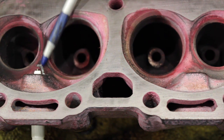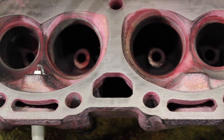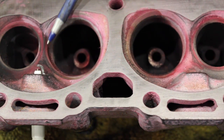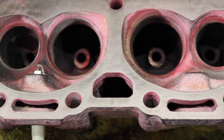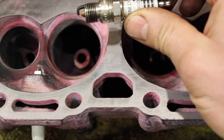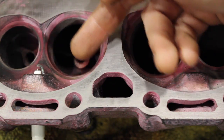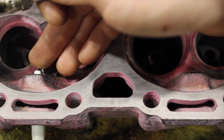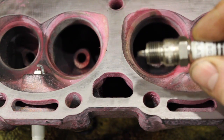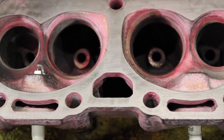Here is a Vortec spark plug threaded in with the proper reach - this is an NGK with a 0.708" reach, a direct replacement for say a C1500 with a 5.7 liter, 1996 and up. It's a TR55GP and as you can see the electrode lines up perfectly with the combustion chamber. Now we're going to thread in the old-school reach plug, which is around 0.430" to 0.431" depending on the manufacturer. Note that NGK and Delco measure slightly differently, but as long as you order a plug for a 96 Vortec pickup, it will line up correctly.